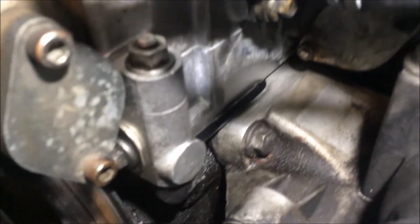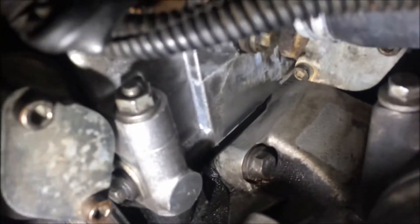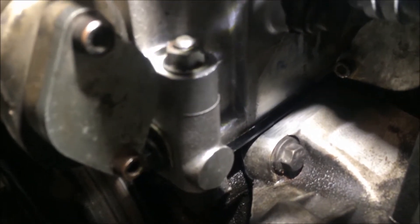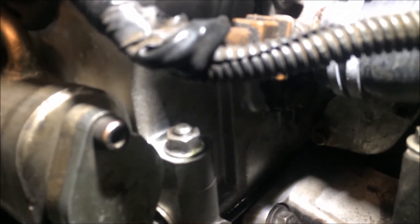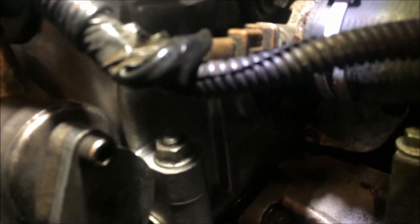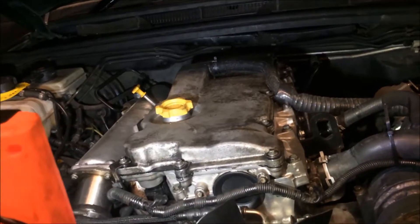I've got a leak — not sure if you can see that, you can see it bubbling. See that? There's something amiss with the torque settings. The torque settings I used auto data for — it works out in five stages: 30 newton metres for stage one, 70 newton metres for stage two, then 90 degrees for stage three, 180 degrees for stage four, and 45 degrees for stage five on the head bolts.